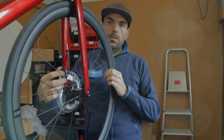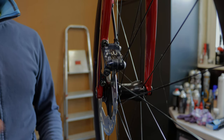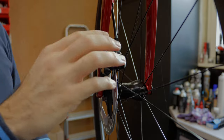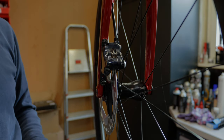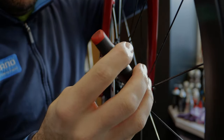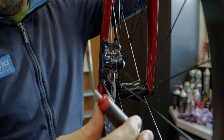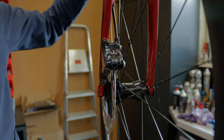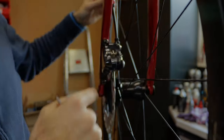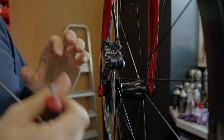The wheel is installed but the bike is not ready to ride yet — we need to set up the caliper. I start this process by pressing the brake, then after pressing two times I tighten the bolts just a little bit. Press the brake, tighten just a little bit — don't over-tighten. Now we spin and see if it's touching. We look from both sides inside and adjust the caliper so we can spin the wheel without touching.